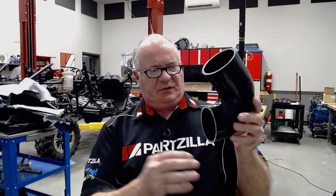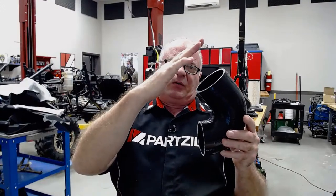This one particular hose is the turbo intake. You've got the turbo sitting here and then the airbox sitting up here. Problem was, the airbox was about that far away from it. Looking at the drawings and photos of it, it didn't match up. So what did I have to do? Buy another one and cut it down myself. Sometimes these all-in-one kits leave a little bit to be desired, but it's probably not their fault. Whoever their supplier was that they were getting that 135 three-inch silicone hose from made a mistake. But whatever, life goes on.